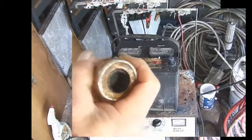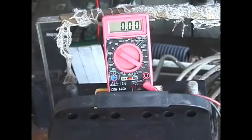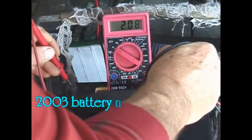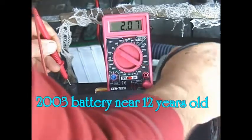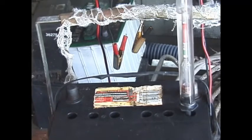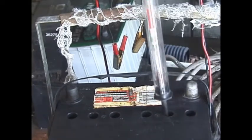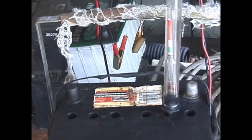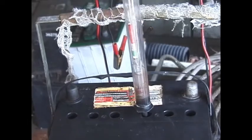Okay, I don't have much hope for this battery. Let's measure the voltage first — we're measuring the voltage at 2.1 volts. The electrolyte is fairly clear and the bulb isn't coming off the bottom. There it just came off the bottom slightly, but you can see it's not even close to being in the red. This battery is dead as a doornail.